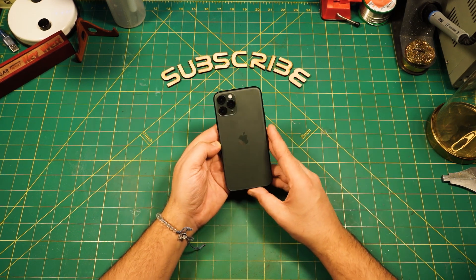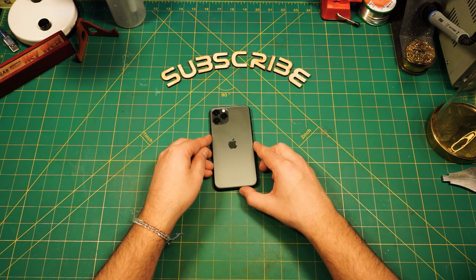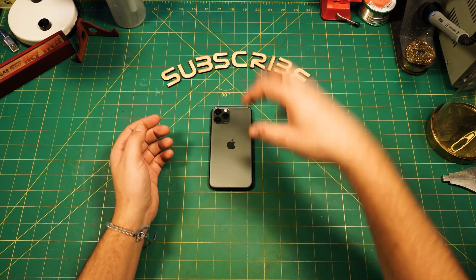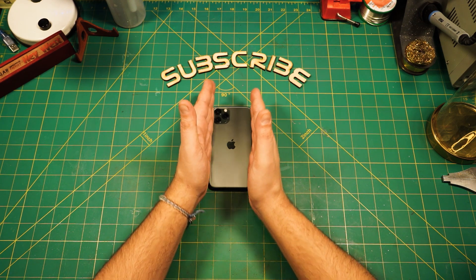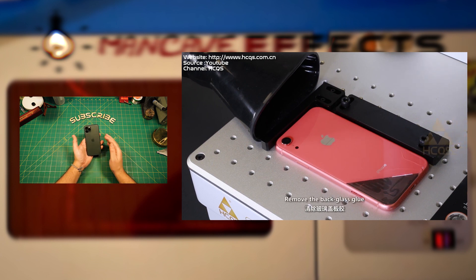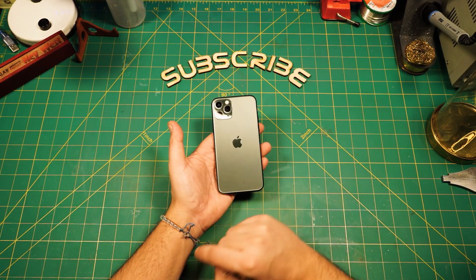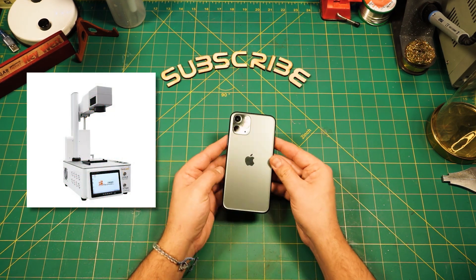So it makes sense that Chinese manufacturers came up with a new solution. They built a laser device — a machine where you put in your phone. It's a fiber laser and you don't even have to align it; you just put it in and it has a camera on top that scans the phone, adjusts the raster and the mask to the position, then starts burning off the glue underneath the glass backing. After that you can simply scrape it off with a spatula for a very low cost. It will spare out the camera segments and burn around the whole area. I checked on eBay — they cost around $2,000 for one of these machines.